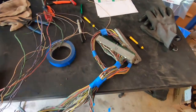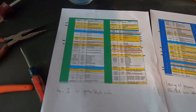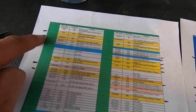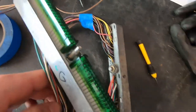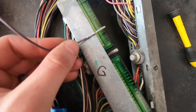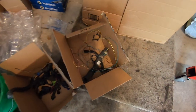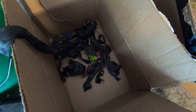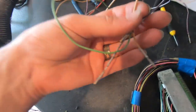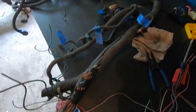Update: I've finished removing all of the pins I need to remove from the two connectors. For example, the delivered torque signal — that's for traction control. We're not going to have traction control here, so it had to come out. I went to the green connector, found the pin numbers on the back, and just yanked it out. The wire either came with it into the bin, or stayed. Other things that came out include rear O2 sensors — we're not using those in this swap, so they need to be removed.